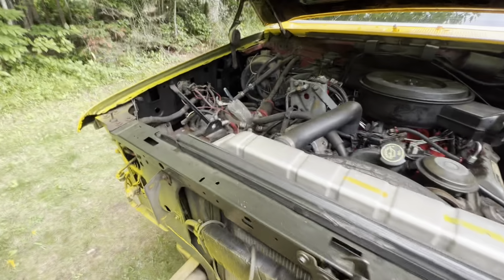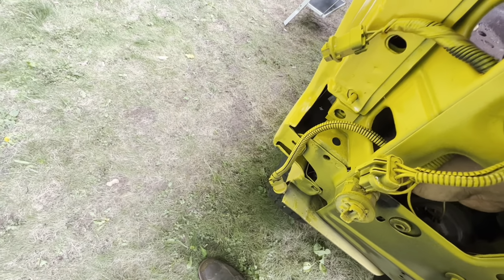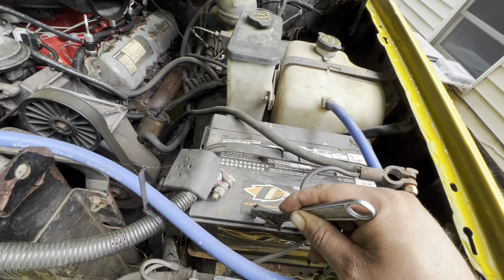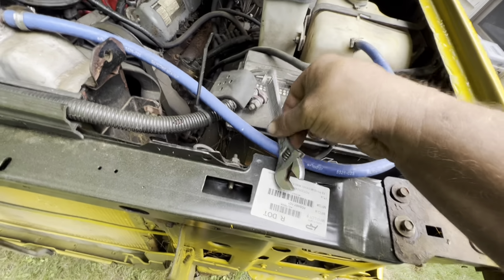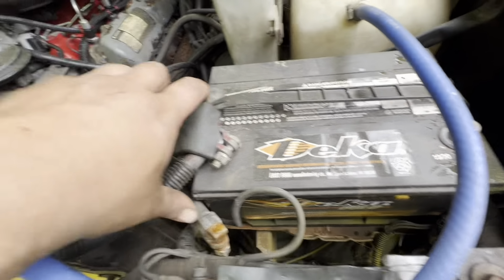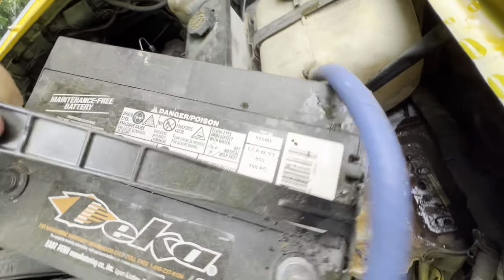I'm just getting the batteries out so that we gotta get way down there to put that doodad on. The one we missed and have to paint. It's got me thinking about how many times I've welded screwdrivers to shit, being in a hurry. Always take the negative off first, because then when you drop the bugger like this, it won't fucking weld to the truck. You know what I'm saying? Because although it's scary sticking the fucker to the truck, it's even scarier trying to get the fucker off. There they be.